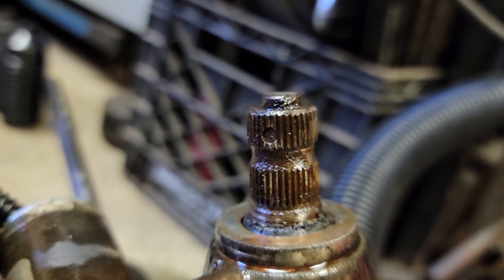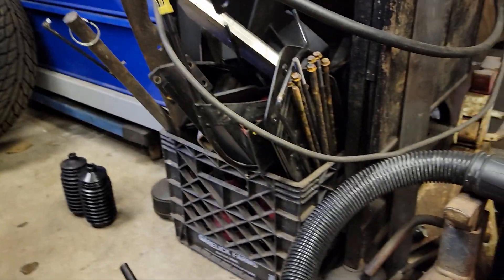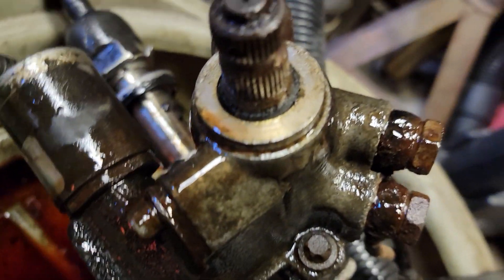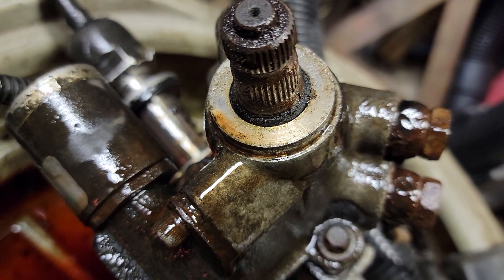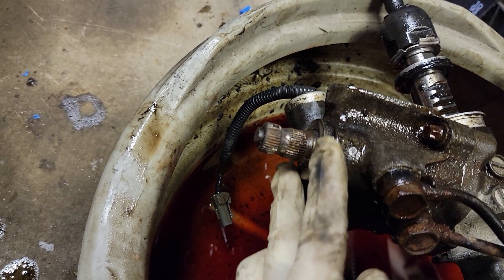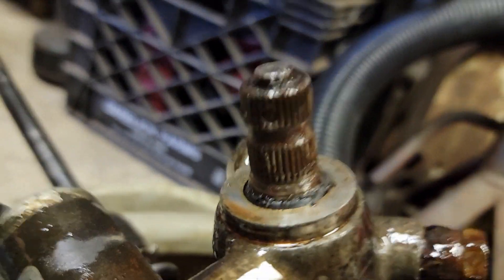There's a little pinhole on the rack - the plastic piece that goes straight up toward the steering rack aligns with that. There's also a little dimple on the spindle part; the piece that lays flat on the lower part here lines up with it. We lined up the two marks on the new rack - it had an extra line, but we think it comes close to aligning with that pinhole.